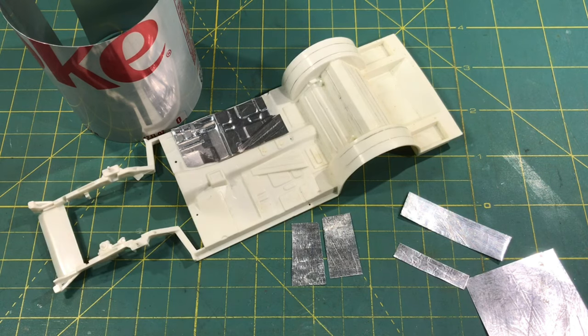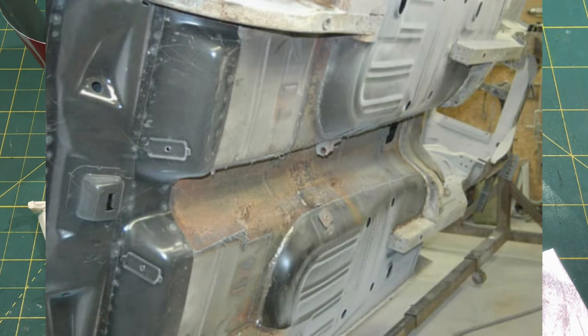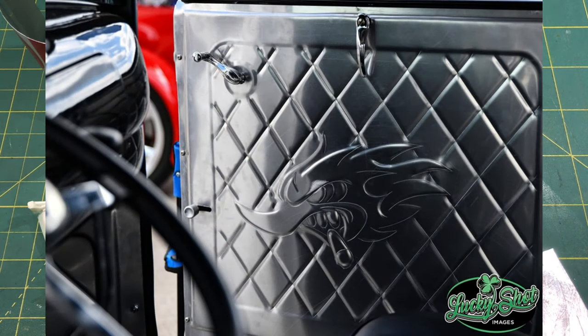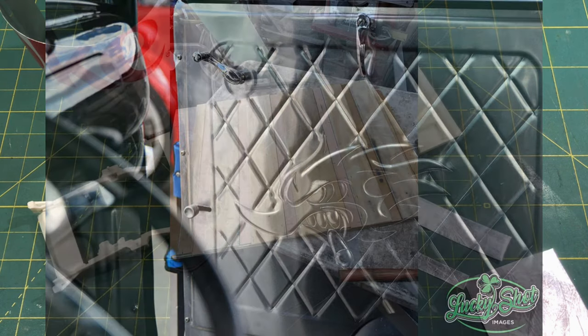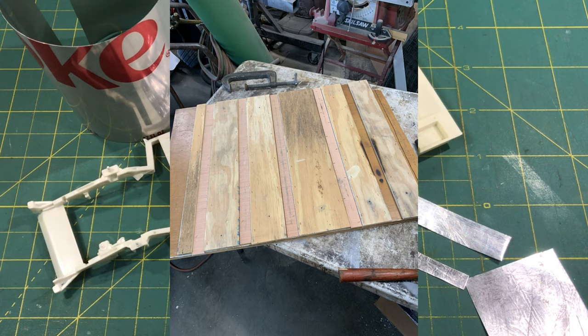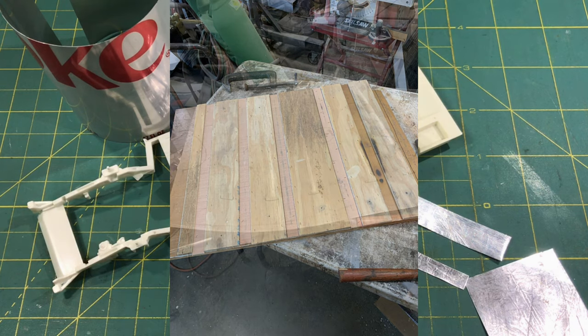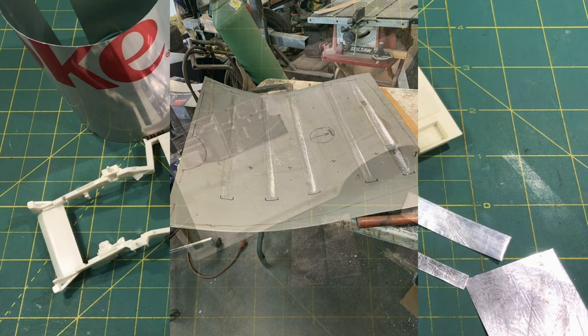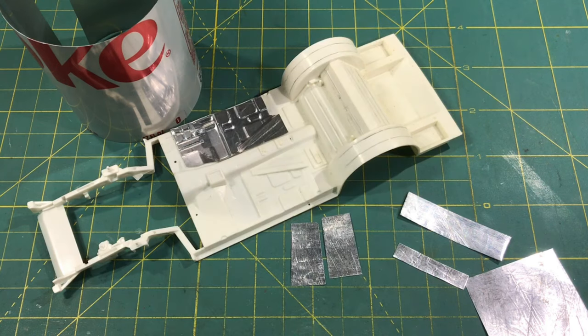Factory stock stuff is usually stamped. Most race cars are too, and some race teams do their own thing. Custom cars and hot rods are a cool thing because a lot of that stuff is custom. As you see in this door panel here, it's really unique. Here's a look at one of the homemade little templates - it's just made out of wood. They lay that over it and hammer it out. And then there's the beading machine that gives you the lines and ridges.